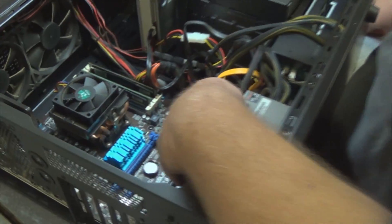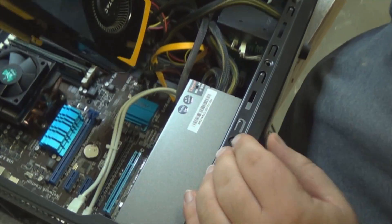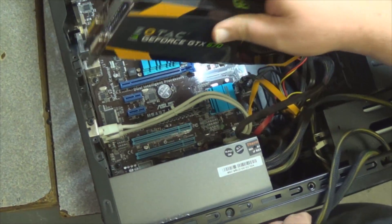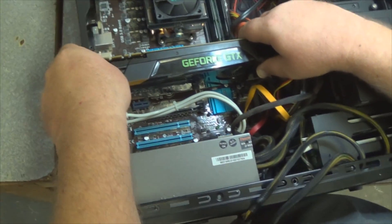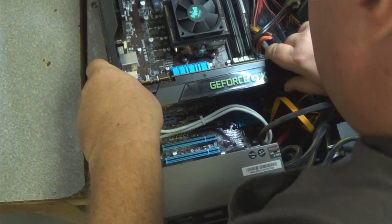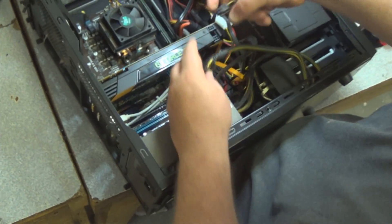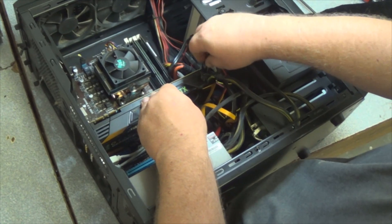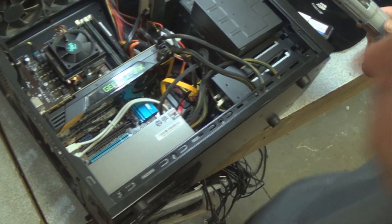You want to put the video card in here. In case you don't know how, a video card goes in the PCIe x16 slot — make sure you have enough room. Most good video cards are a little bit long. This is a GTX 670, 4 gigs of DDR5, and it requires two six-pin connectors. Then afterwards, screw your screws back in.